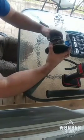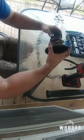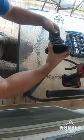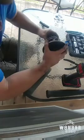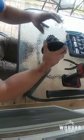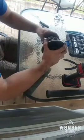I have an exhaust housing that does not have a welded wastegate like my turbo does, so I'm gonna replace the exhaust housing at the same time so I'll have a wastegate again, because the compound without a wastegate doesn't really work as good as it should.